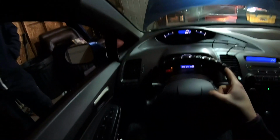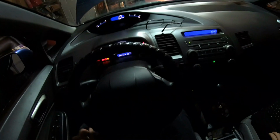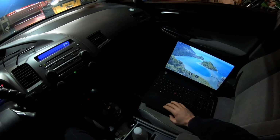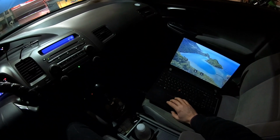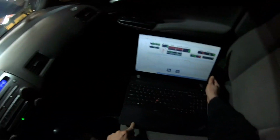Check your heater, your O2 heater warming. And no, not on this. But this should warm it up, right? If I clock it, I think that warms up the O2 heater a little bit. Check engine light's on. Yeah. You know what they say on those AEM wideband sensors? They say if you keep it in the on position for too long while tuning or adjusting some stuff, you're going to burn out the sensor. Yeah, it overheats or something.